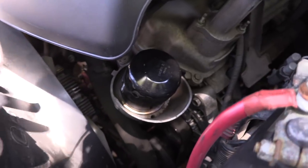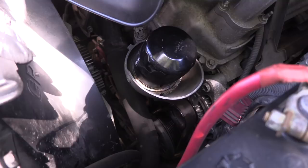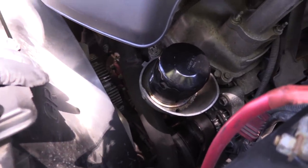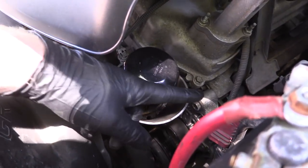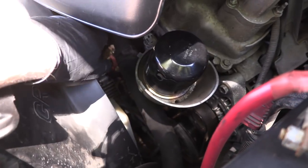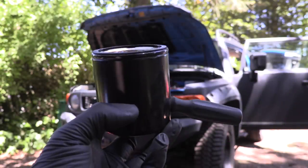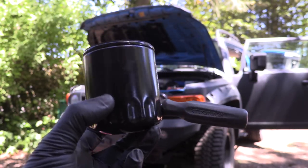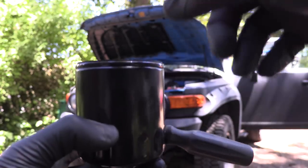If your oil filter is completely stubborn and stuck on there like mine is, you've got a couple options. You can get an oil filter wrench, or you can do the DIY at-home thing I don't recommend: take a screwdriver, tap it with a hammer through the oil filter horizontally so the head runs through it, then grab the handle and turn it counterclockwise to unscrew the filter. Oil filter shish kebab — I don't recommend it, but if you've got no other choice, it works. And this is a reminder not to tighten it as hard the next go-round.